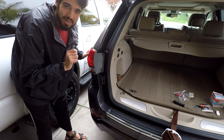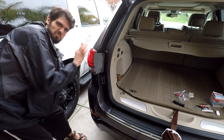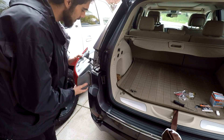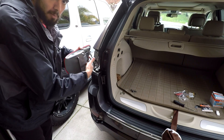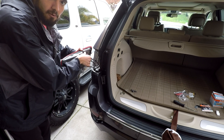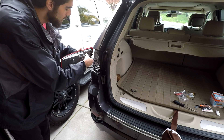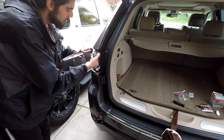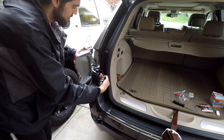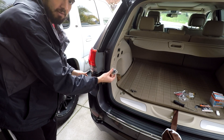This would probably be a good time to remind everyone — this isn't actually my car anymore, this is my mom's. So sorry, mom. The paint is good. But anyhow, we're going to go ahead and pull this out. Looking from the top down on the back of the housing unit, the first light bulb up here is the brake and turn signal. So we're going to give it a little turn counterclockwise and pull that bulb out, just like that. We can pull it off over here to the side. Instead of having to undo the rest of these connections, we'll just go ahead and sit the unit back while we play around with the rest of this.